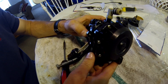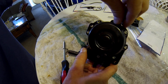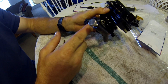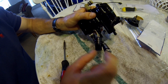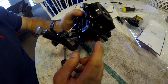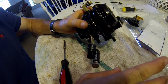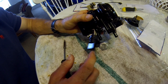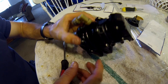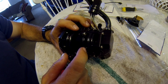Now I'm going to go ahead and reinstall it on the boat. I'm not going to make a video of that because it's really simple — just taking three screws out like that, one in there, one in there, and one in there. Then you've got to hook in two oil lines and plug this thing back in. You see this is cut off — I'm going to hook this back together. There's my oil line coming in, the fuel line coming in, and the fuel line going out. I'm going to hook my oil back up and plug in the other two plugs I disconnected — one was for the alarm. Get these plugged back in and hopefully this VRO system works again and my boat will at least pump fuel. I hope that helped out if anybody needed assistance seeing how easy it was to rebuild your VRO fuel pump.